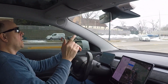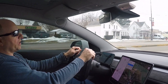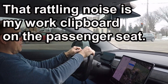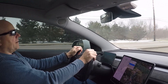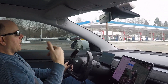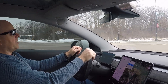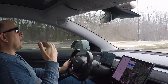The car is nice and quiet now because I switched back to the stock 18-inch aero wheels and tires. I don't have the aero hubcaps on it, and I did that not because I dislike my 20s or because these wheels and tires are somehow better — they're only better in that they're more efficient. I was starting to have road noise coming from my 20-inch wheels and tires, and more and more people were asking about it: 'Hey, what is that noise? Do you have bad wheel bearings or is it the tires?' No, it was the tires.